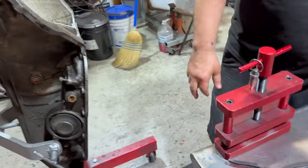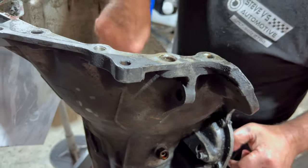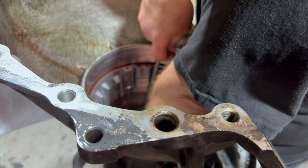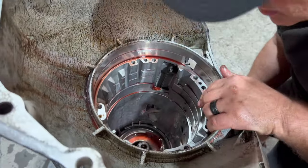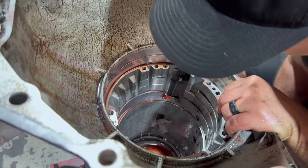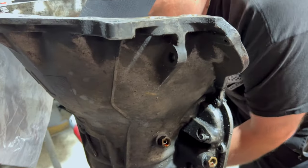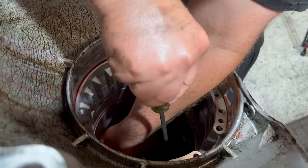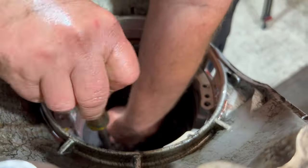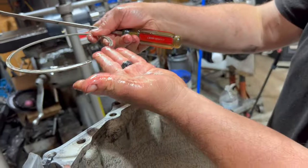And we are down to it. We'll get this snap ring out real quick. And I'll have a special tool. It has a cute little name that I'll tell you when I get to it. Sometimes going through the bottom, through the side. There it is. You just have to walk it around. And if I had a bigger screwdriver with more meat to it, this would be done by now. This is also beveled, so flat side down, beveled to the top.